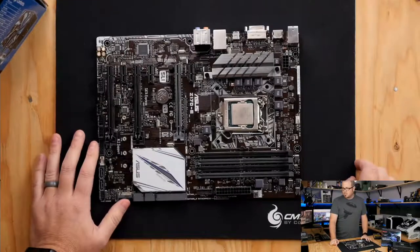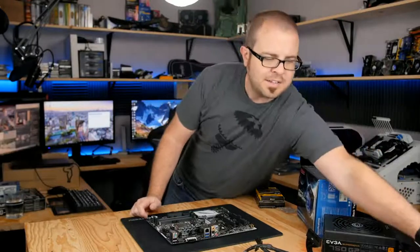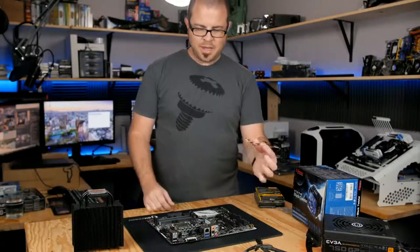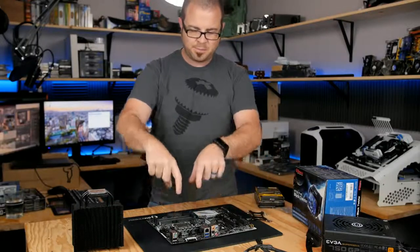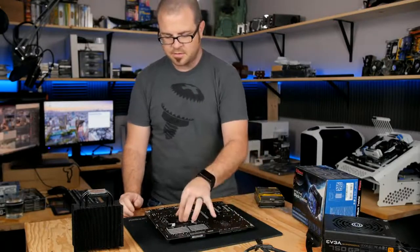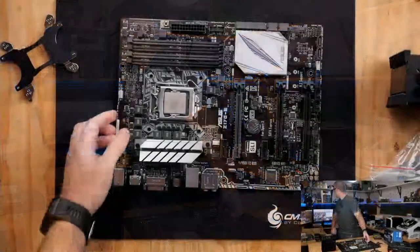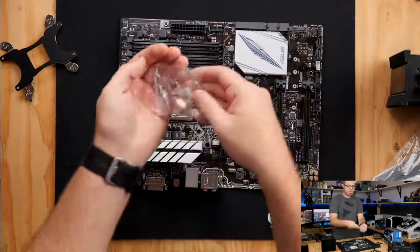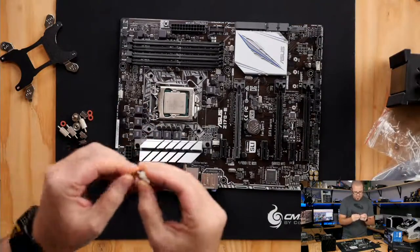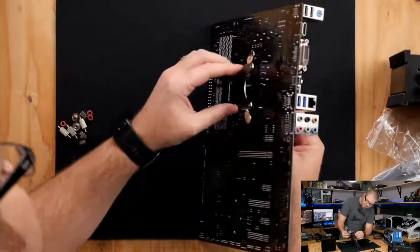Now the hard part — almost always the hardest part of builds like this — the CPU heatsink fan. I've already taken everything out of the box. We have a back plate; normally a heatsink fan you just align and push in the four corners, but in this case there's a back plate that goes on the back of the motherboard. That's the other thing about aftermarket heatsink fans — they're all kind of different. If you're not using this specific Enermax one, there's a good chance any instructions I give here won't apply completely.